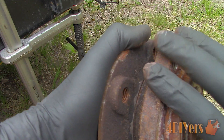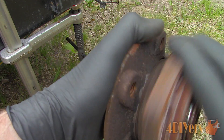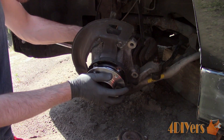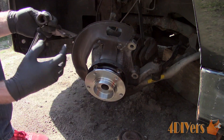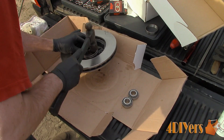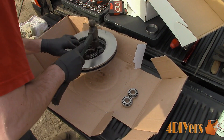As for the BMW, it's a very similar system where the wheel bearing assembly is held on by a flange to the spindle. But this isn't a drive wheel, therefore there is no need for an axle and there is no spline. Such as this front wheel found on the two wheel drive Ford Ranger — as mentioned earlier, it uses a tapered roller wheel bearing, which is a serviceable design, unlike the two examples from the BMW or Volvo.